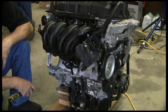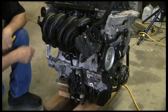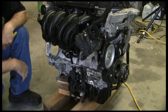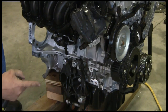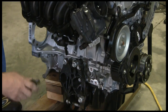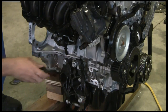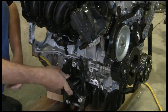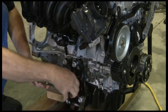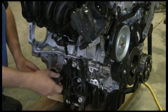Remember, you may have seen this bracket a couple of times from different angles under the car. We had to release the carrier tube for the drive shaft. This axle also held the bottom mount for the engine. And now we're going to go ahead and take this bracket off because we're going to have to use this again, or figure out a way to fabricate something that will hold our motor and also support our drive shaft bracket. Thirteen millimeter — this looks like we're just going to pop off three bolts, and that will take care of all of this.